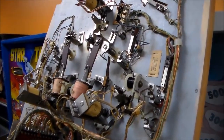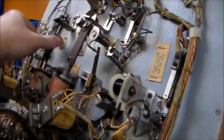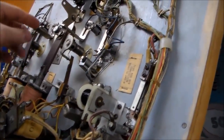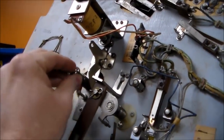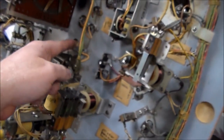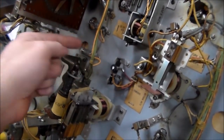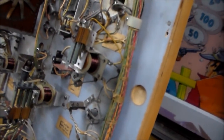Okay folks, we're making progress. We put the flipper coil stuff back together — you can see they're nice and springy. I also oiled the little pop-up thing — there's a little thing on this game that can pop up between the flippers. I also went through and replaced all the light bulbs that are under the playfield. Whenever you do that, you have to clean the inserts — there's a little plastic insert the light shines through, and sometimes on these old ones they are filthy.